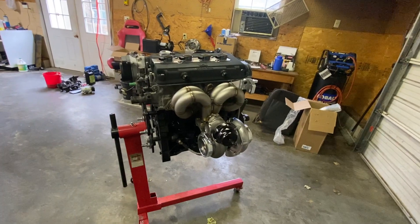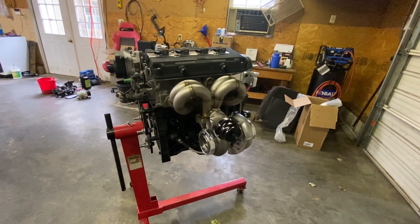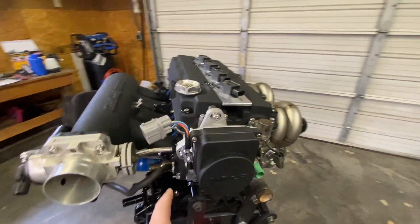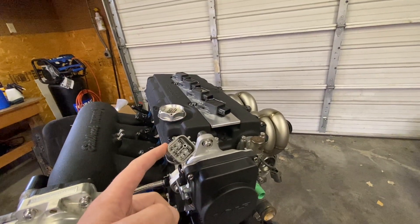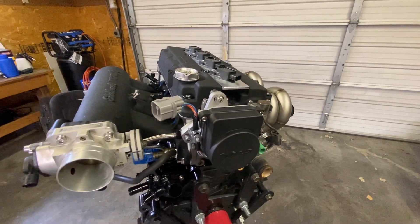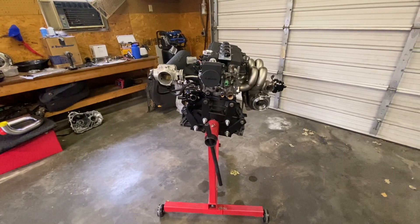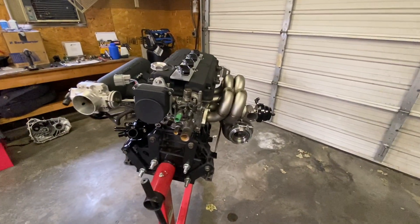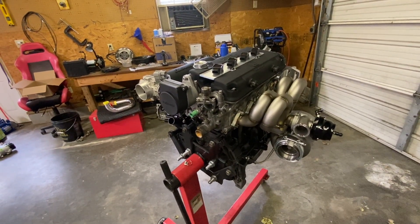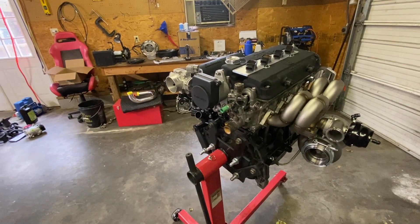This turbo itself has a three-inch V-band outlet, and that V-band we're going to route through the bumper — I believe that's the route we're going to go — and then we'll turn the dump tube down to vent to the ground. I went ahead and de-pinned the stuff that was needed to remove from the distributor on the VMS cover. A lot of the stuff left to go is really just stuff that can be done inside the car. The B20 VTEC turbo kit is mostly complete. We're also going to be testing a Snake Tuning RTP-style board in one of the cars in the future, and this might actually be the one we test it on — a lot of good stuff to look forward to.